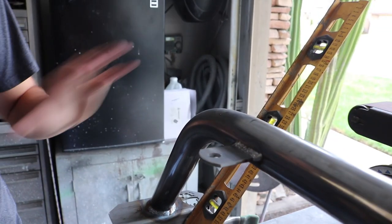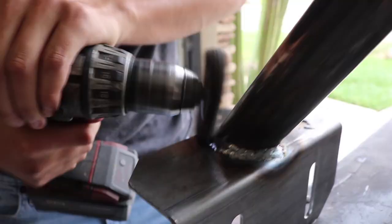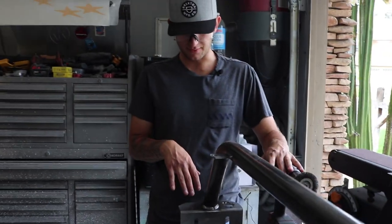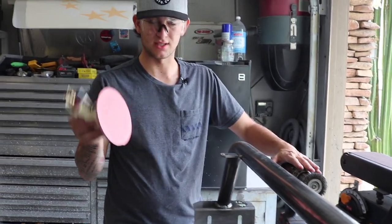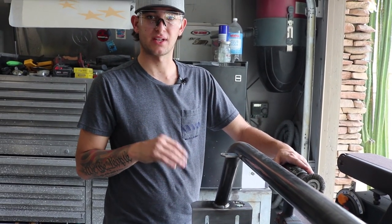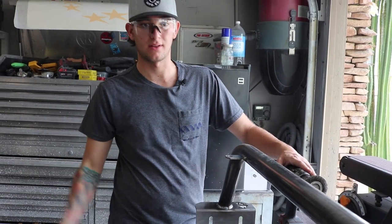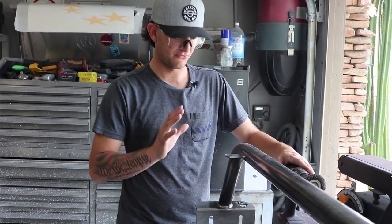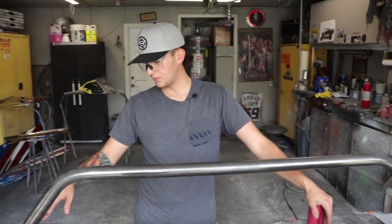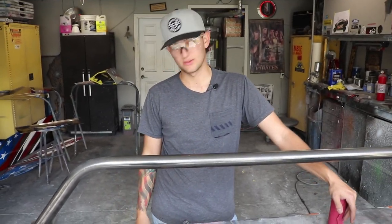I wiped off all the oil so I can weld on it, just to get that primer on there so we have no rust and can get the best paint finish possible. Now that we got it wire-wheeled and have all the contaminants from the welding off, we're gonna give it a quick sand with some 150-grit with a DA sander. That's to give the primer something to stick on, just to etch it a little bit. We'll also use a self-etching primer, which will help the primer stick so that it doesn't peel off in the long run and stays factory looking and clean.